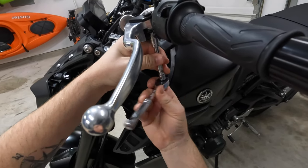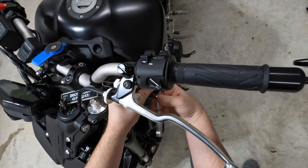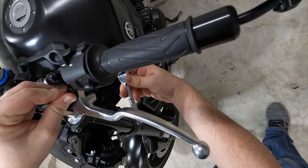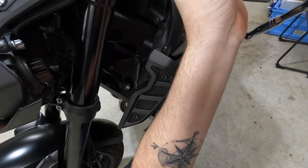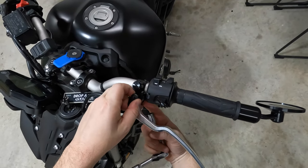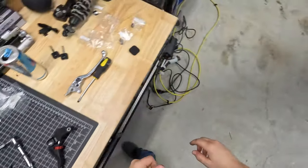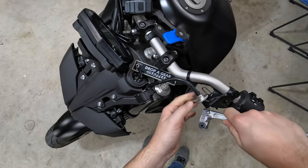So basically what we're doing here is just unscrewing the clutch lever - one of the easiest mods to do to your bikes, guys, and I think potentially one of the best looking. I think it gives the bike a fresh look. Now there we go, we got the nut - we'll push out the pin that holds the clutch lever. This does have little notches on it so you can see how that fits back in there.